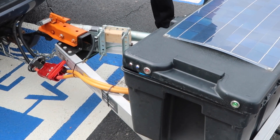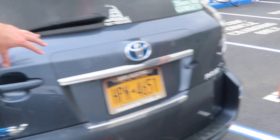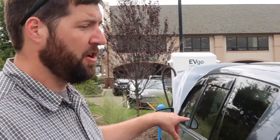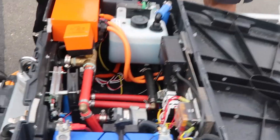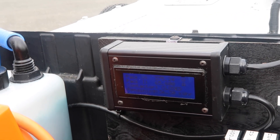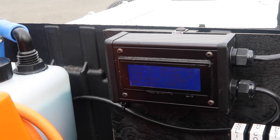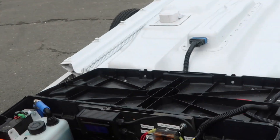So you control the contactors from this box? Yeah. And then for safety, I have another set of contactors in a box that I put in the back of the car. I install the switch on my dash — so in order to charge, I turn this on first, come over here, usually start the charge first, and then hit the button on my dash to close these contactors back here, and then they're actually in parallel. Inside the box is my pump, the controller which shows pack voltage and current going into the pack, and status for the contactors. Right now it says closed — pack voltage 375 volts, 65 amps — and the bottom line cycles through different stats like max temp.